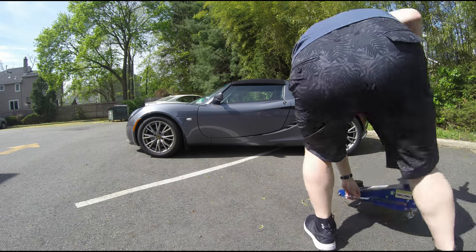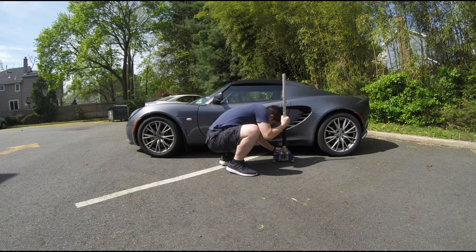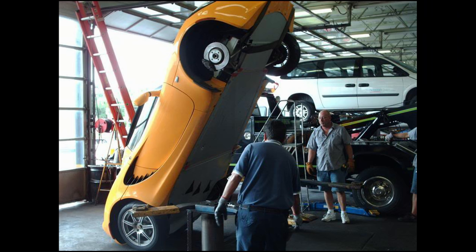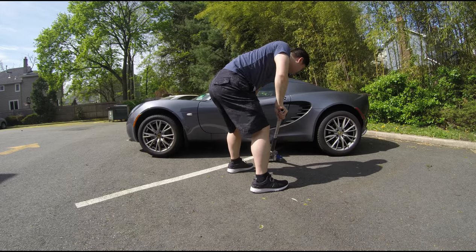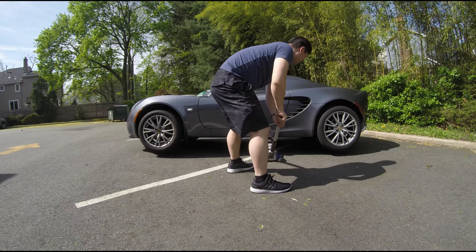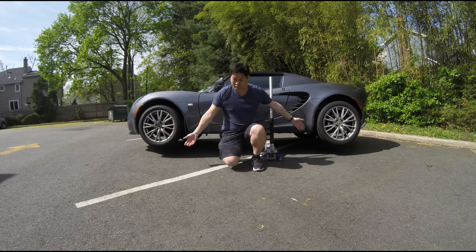The lift points are an interesting one. There are a lot of different lift points on this car and you better read your owner's manual if you're going to jack it up at all — don't trust just anyone. You can't typically jack it up on a four-point lift like a normal car. An interesting way to lift it is using the side lift point, which actually lifts up the whole side of the car at once. Since the car is so light, it really works and makes doing wheel and tire work very quick and easy.